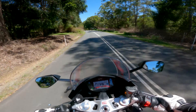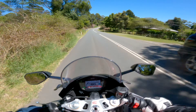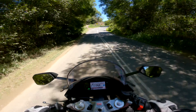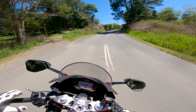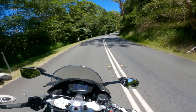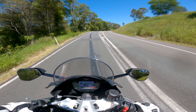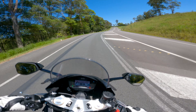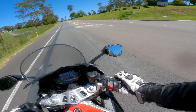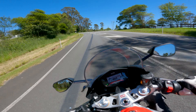This right here is my motorcycle suspension test road — it starts off smooth and flowing where you can get a bit silly, then it turns into a bumpy, cornery mess. On the smooth section it feels fantastic — could use a little bit more preload in the back as it feels just a little bit low, but besides that great. On the changing road surfaces it's pretty good so far, a little bit busy in the rear with a couple of bigger bumps, but handled them pretty well. The front suspension is pretty good; the rear not quite as good — feels a bit busy and like it's almost bottoming out.